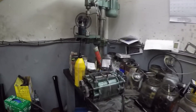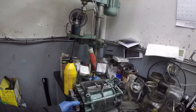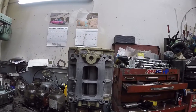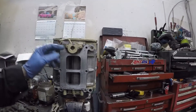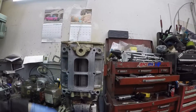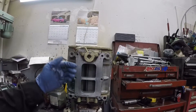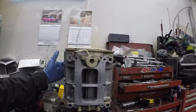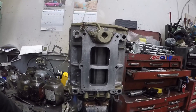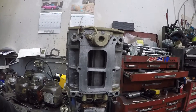So here's the old blower off the engine — that's a natural blower. And then this one is a bypass blower, off a silver series. This actuator bypasses the blower, so as soon as the blower senses six PSI it opens this valve, which equalizes the pressure on both sides of the rotors, and they're just coasting.